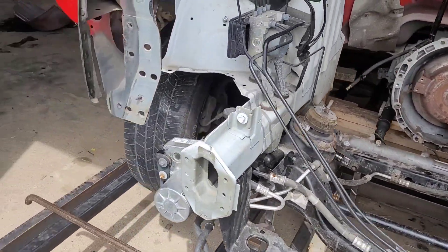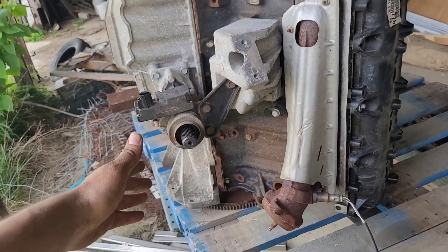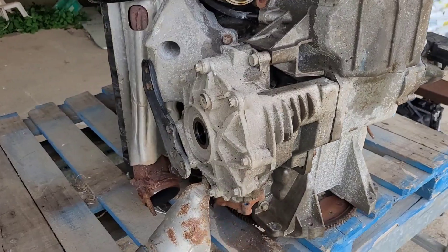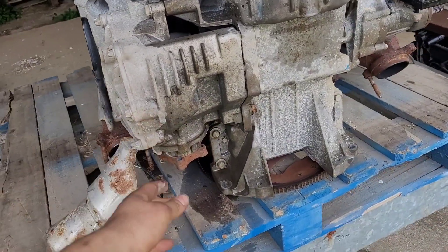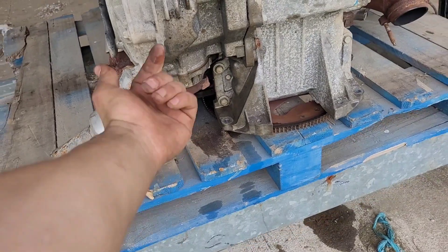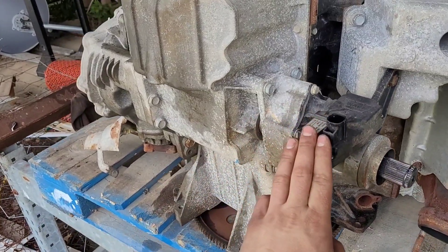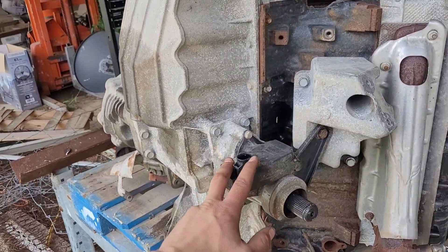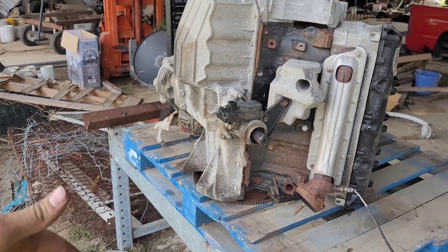I have another block motor just ready to go. Here's the motor that came out of the thing. This is a 5.7 Hemi all-wheel drive — you can see the AWD oil pan here is where the axle for the passenger side comes out. This is the driveshaft joint that comes from the transfer case from the back of the transmission, and then this is the driver's side. This is basically a switch on-and-off system, so it was not all-the-time all-wheel drive. I'm probably going to do a toggle switch on the inside of the car so I can flip it to rear-wheel drive or all-wheel drive.